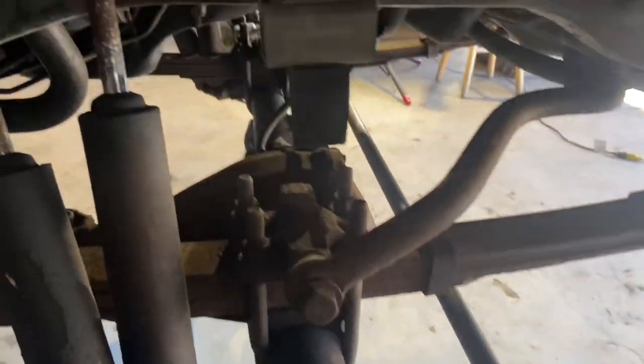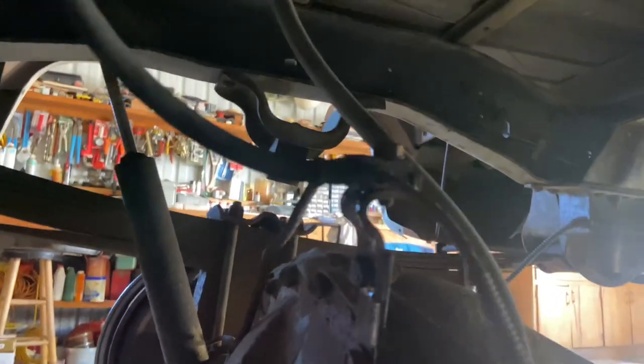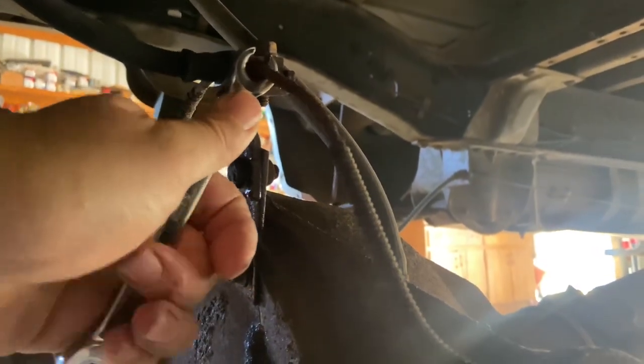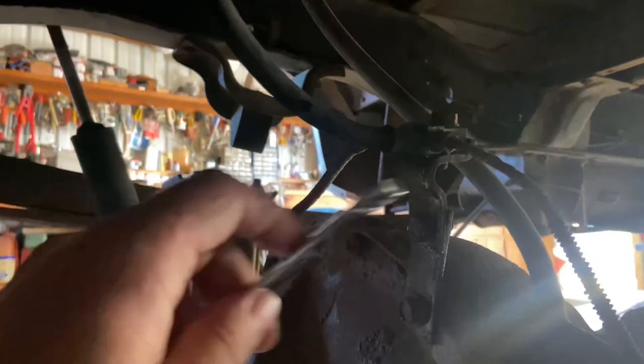All right, I'm gonna use two hands and two eyes to find this. So I was hoping to save these hard brake lines, but unfortunately, if you come back here, let's see here. See if I can get the camera to focus. These rear ones are particularly bad. If I get this guy, see how it's just flexing the entire line? So that's just gonna break right off. And it's doing the same thing on both sides of the block here and on both wheel cylinders. It is corroded there as well.